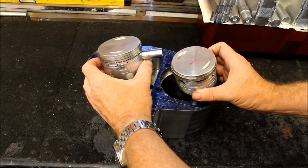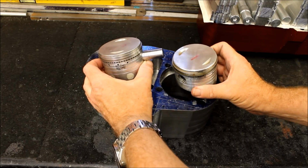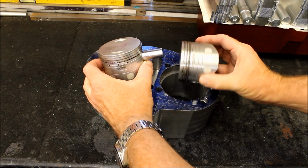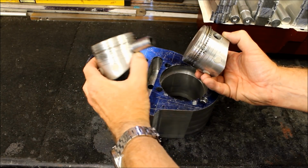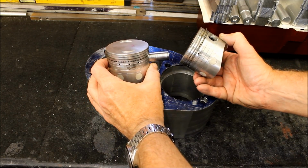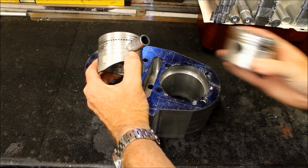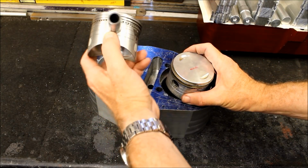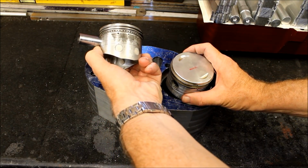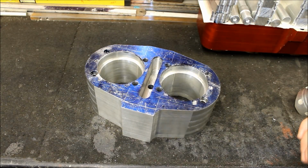I mean, not ideal. You want to really use brand new pistons, but you know, we can't afford that. They've not done much work. It's just that on the Kawasaki, when you run it, the trouble with running a supercharger is the extra pressure is trying to force. So has this been used on a blown engine? It was used on a supercharged Kawasaki. Okay. And they've very little oil on the cylinders to start with. Hence, it starts to scuff. You can see there. And in a road bike, you can cause problems. Yeah. When you supercharge it, you're increasing your problems.